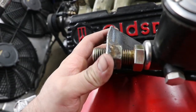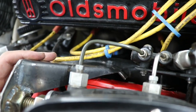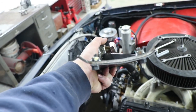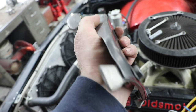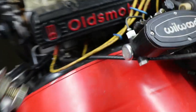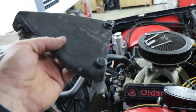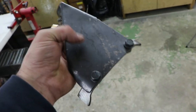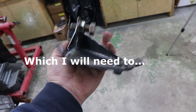I'm adjusting it to get this as flat as possible, and the nice thing about not welding that chassis bracket on right away is I'm not stuck doing a lot more modifications. I put a little bow in it which will help make it more rigid, and rounding that edge over will help make it structurally sound in this direction. Now I just need to clean off some paint and tack the main mount onto the chassis, then pull the bracket off, finish weld it, and refit it. The nice part is it'll be removable — so if I want to add a dimple die or extra bracing later, I can.